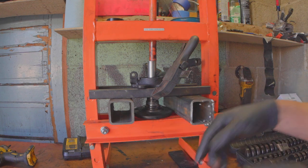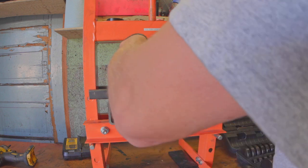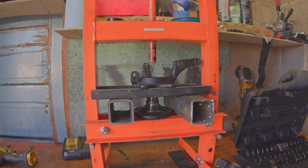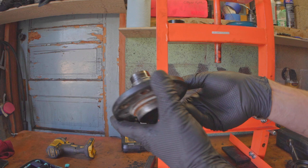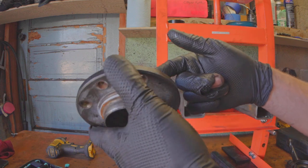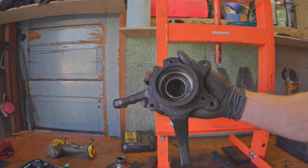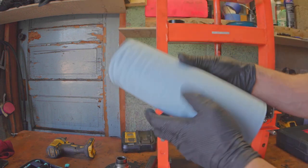The inner race is still on the spindle, so we're going to cut that off. Now we're actually fully out — that was a pretty good setup all things considered. So now we have our spindle, and you can see the race is still stuck on it. We have to cut this race off the spindle — at this point just throw away all that inner junk that goes inside there, they're toast to begin with.